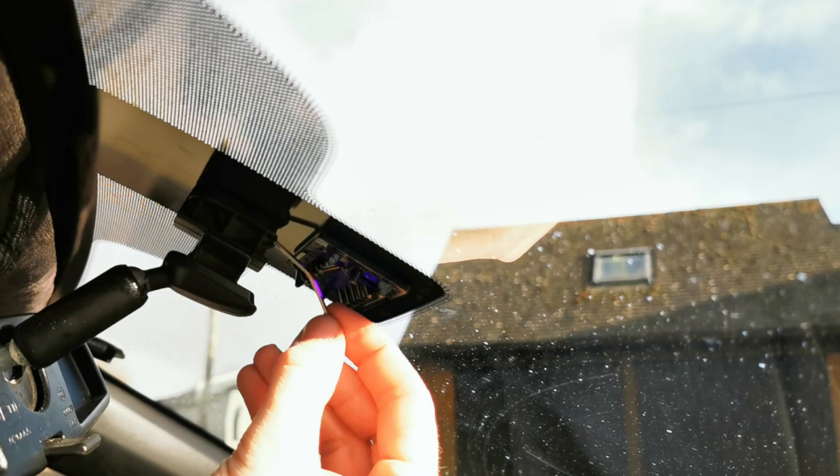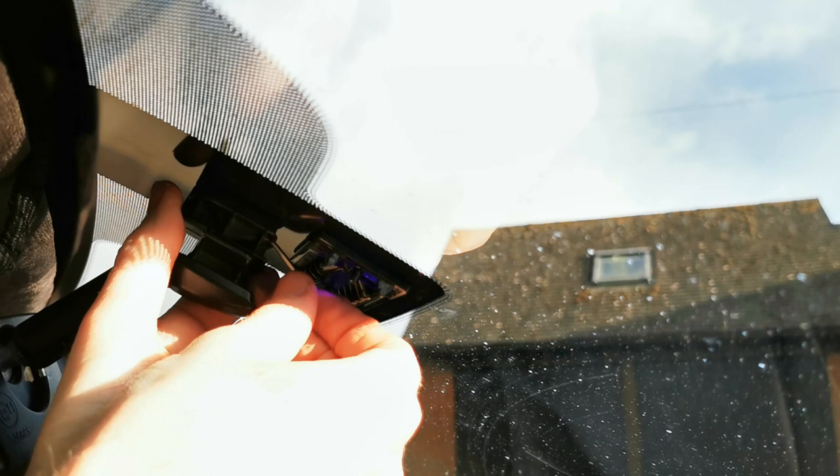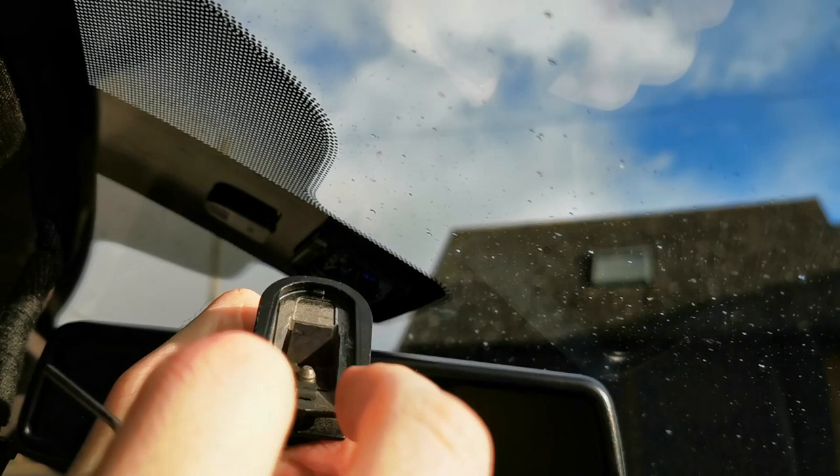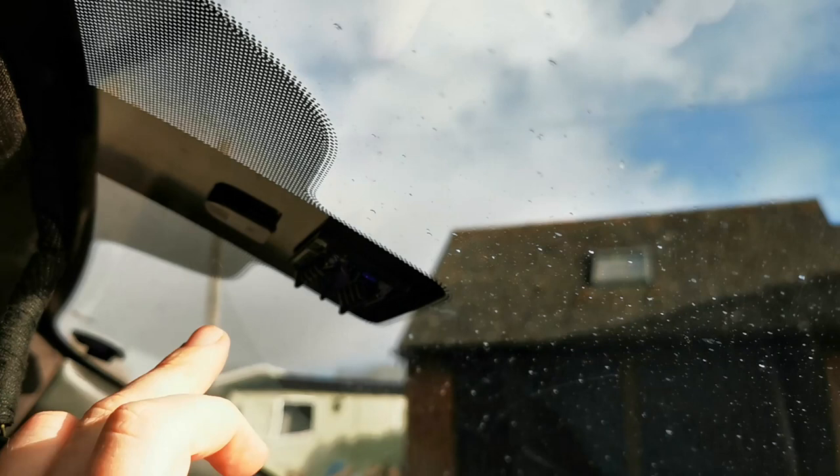This is a 2.5mm Allen key. What you need to do is just push it in. I'll show you the base of the mirror when we get it off — there's literally just a metal tab at the back. If you just push it, off it comes. It slides upwards and it's this little metal thing just here. What you're trying to do is push your Allen key against that so that it straightens it up and pushes it that way. It then just sits on a little friction surface on the metal base which is stuck to the windscreen.